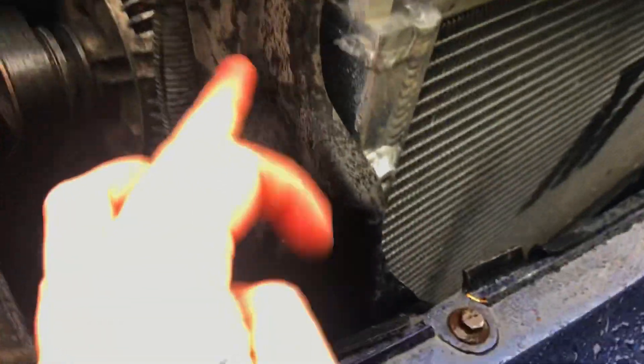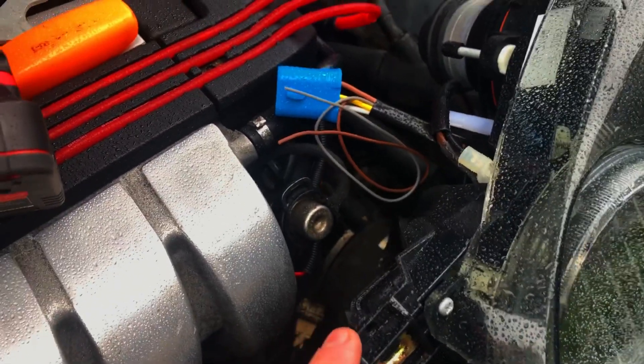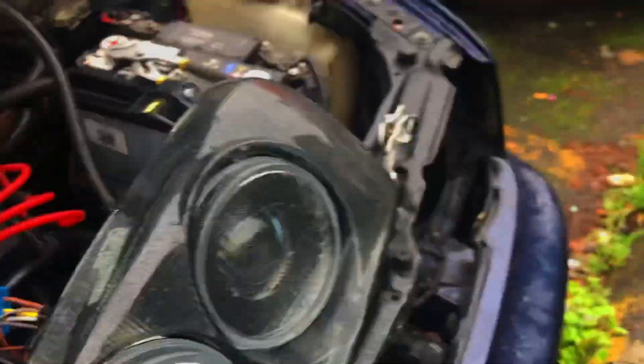On these, some slight modification has to get made. Got to cut out a little bit of this radiator core support so that way it adds a little bit more clearance. And then also, a little tiny bit — at least on mine — this mounting tab has to come off just a little bit, just enough so I can get clearance.